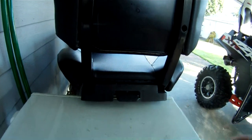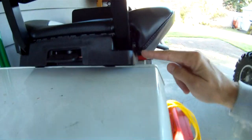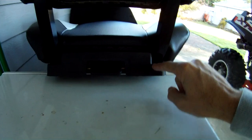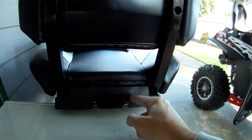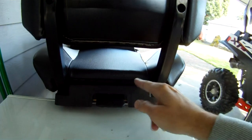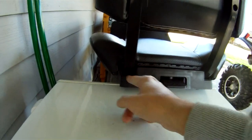Here's a picture of the stock seat. You're going to want to take your Sawzall and cut this plastic tab flush with the base. You're going to want to cut straight across here to this first ribbed portion of the seat. Sawzall that flush all the way down and then it opens up this whole space all the way to the front. Obviously do both sides.